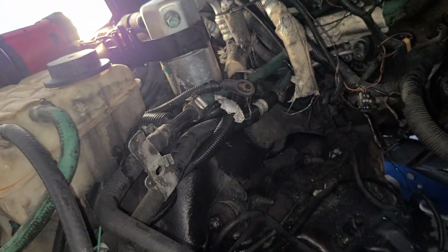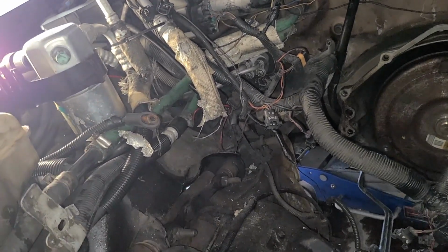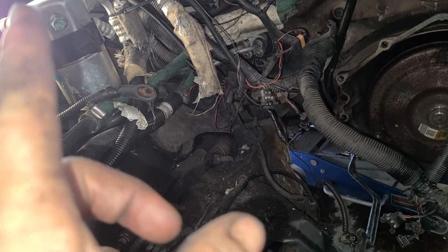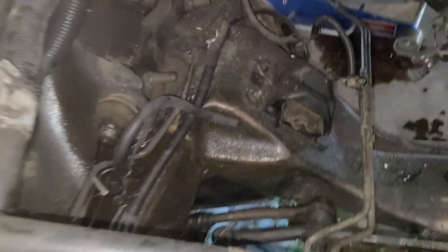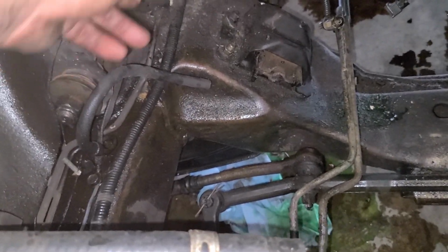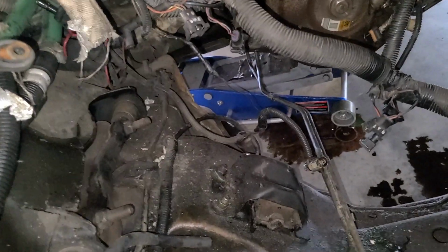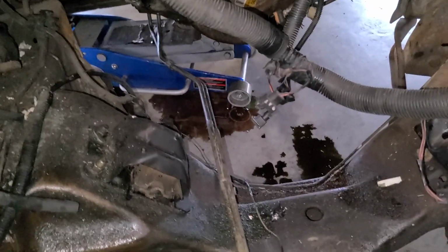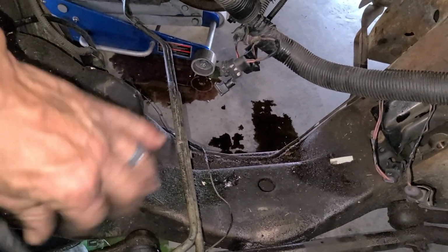So I had the shop come over. He pulled all the freon and the oil out and disconnected the lines. They're up there. The good thing about these lines is that they're pretty long. The LS compressor sits down over here and has kind of an up mount. Those were rear mounted, so I could probably get lucky enough to reuse these. I have them zip tied up out of the way, and I can just bring them down to the new compressor when it goes in, picking up more bolts and ground straps that aren't hooked up. But we will get it all sorted out.